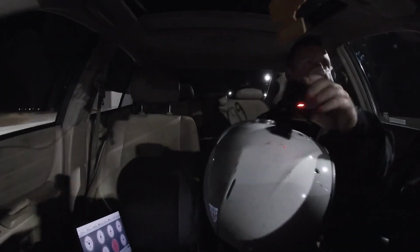Damn, I blew it. So the reason I failed there and lost that race is because the trans brake malfunctioned. Trans brake was holding, I was trying to bump in, and it wouldn't bump. I was hitting it, and then it finally tried to bump, but the brake stuck, and it pushed me through the beams, and that was it.